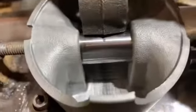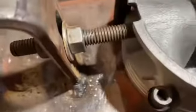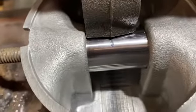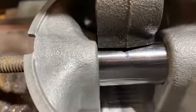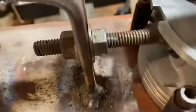I check it to see where my center is so that when I push my wrist pin in all the way, I know it will stop right there as it should. And then when I bring my wrist pin in and it cools, it'll stay centered.